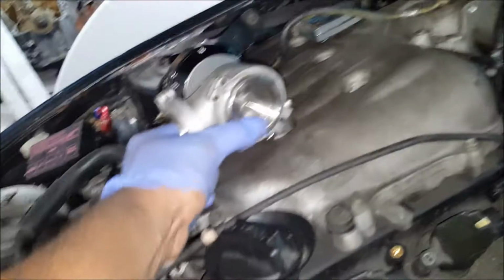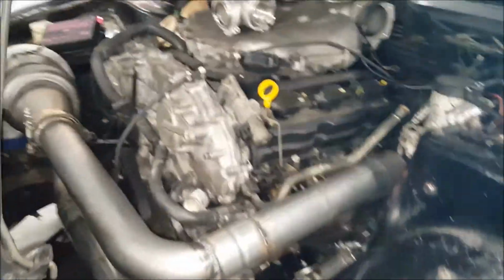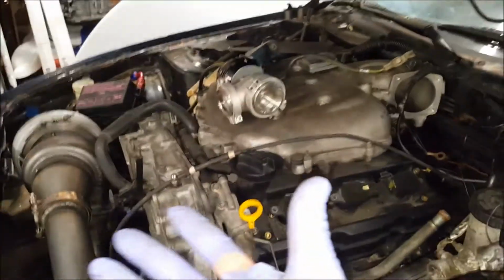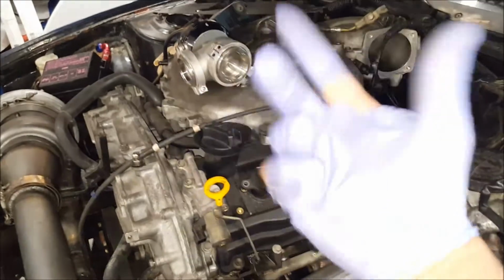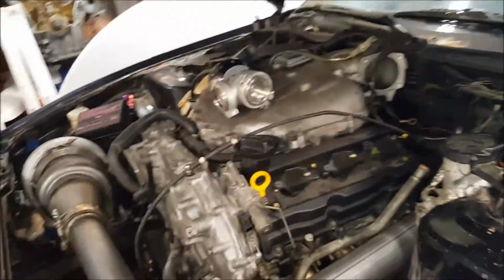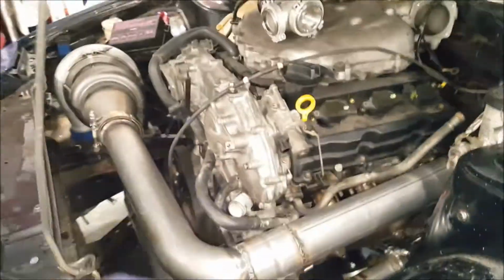That locks this valve. Well, they came loose, and that's how I blew my first stock KA. I didn't have boost protection, and basically the diaphragm was working, but it wasn't pulling up the valve to regulate the boost. I don't know what I hit, but I know I probably made more than 400 horsepower because two of the rods were bent,